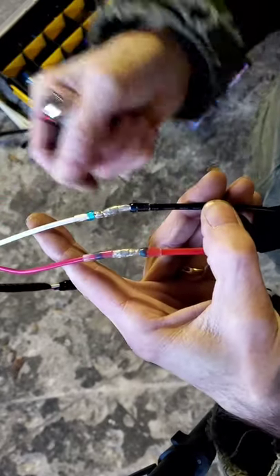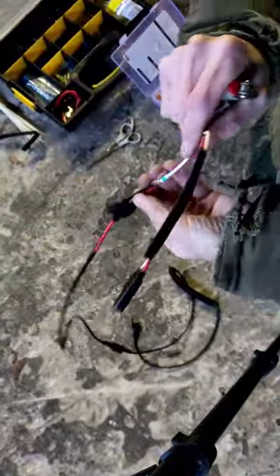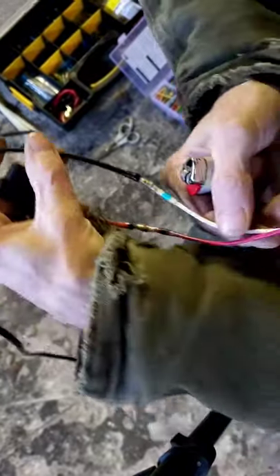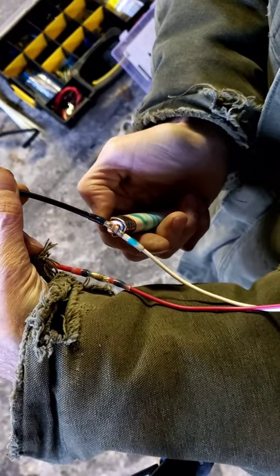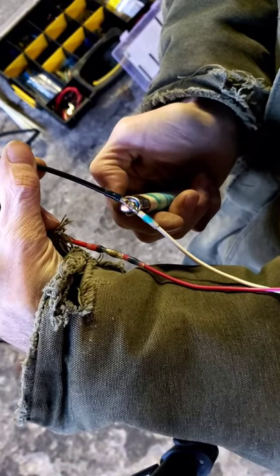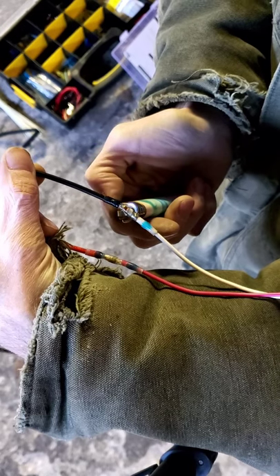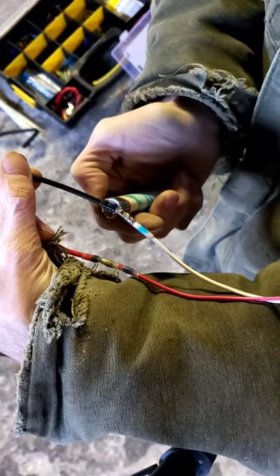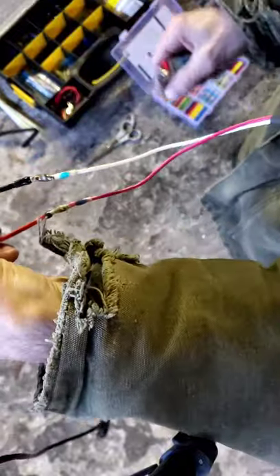Be careful you don't tug it — when the solder goes dull, it's cooled enough that you can go ahead and flip it over without worrying about anything loosening up. Now I'm just going to heat that bottom side. Nice — and there we have it.